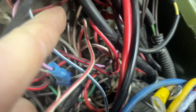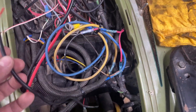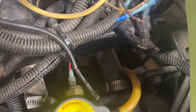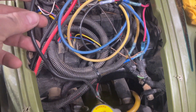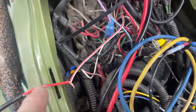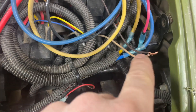At the red and white junction, you can take another piece of wire — there are a lot of harnesses laying around — connect it down onto there to that power. The red with white wires run to the fan, and this is the ground to the fan. I'll show you a quick test just to show that the fan is working.